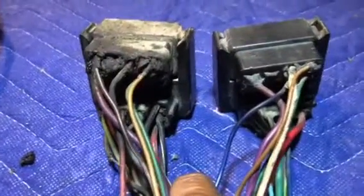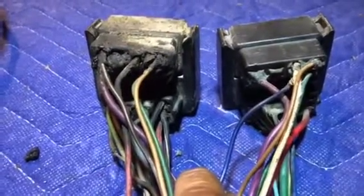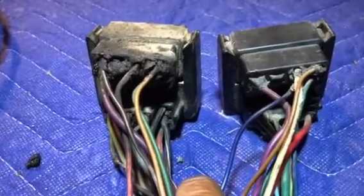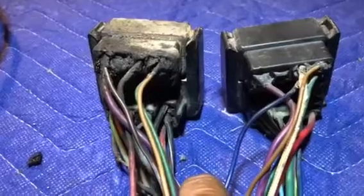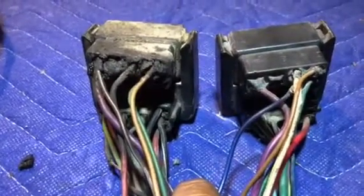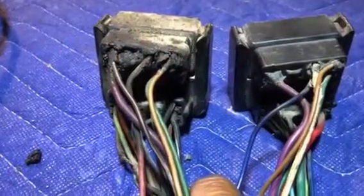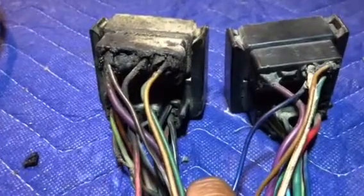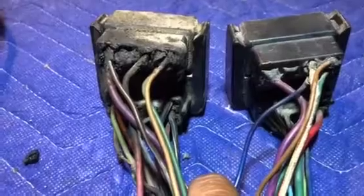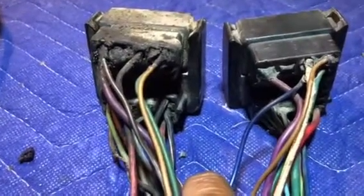So when you go over here to the left, you have the tan wire, which again goes to the proportioning valve. That way when the master cylinder loses pressure, it sets off a dummy light that says brake. Then underneath that, you have a green wire, which goes to your temperature, goes to the cylinder head. And then the wire that looks black, but it's actually pink when you get down lower, that goes to the HEI distributor. And then the purple, that goes to the starter solenoid.